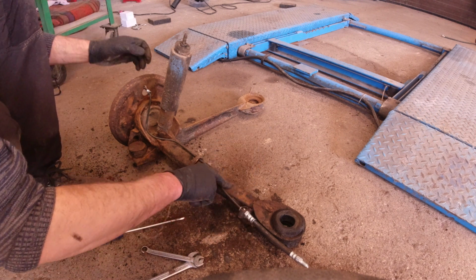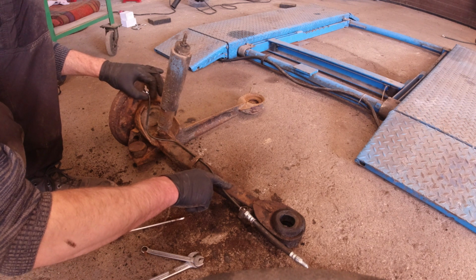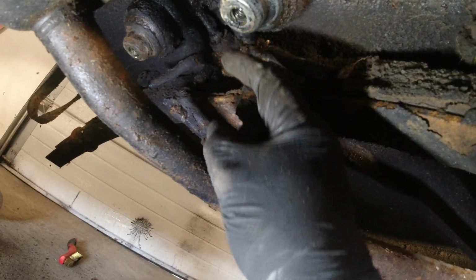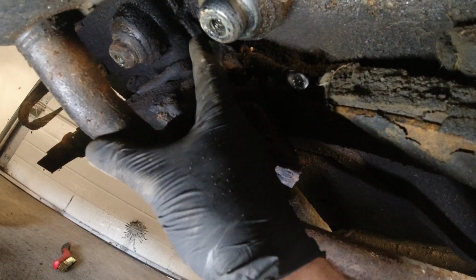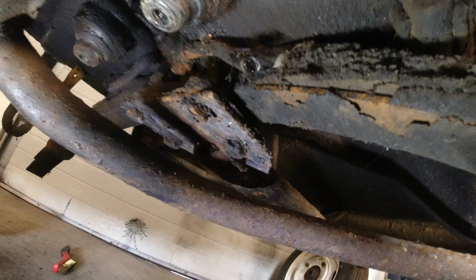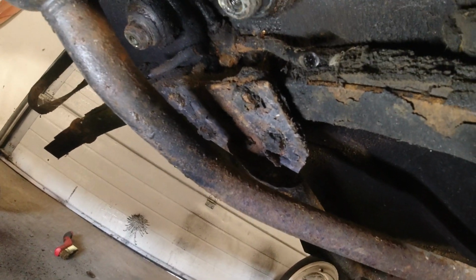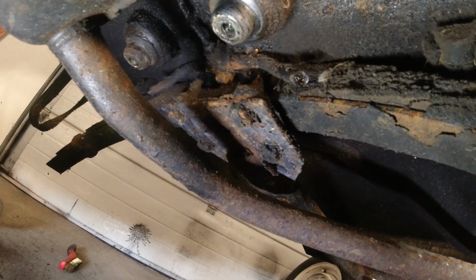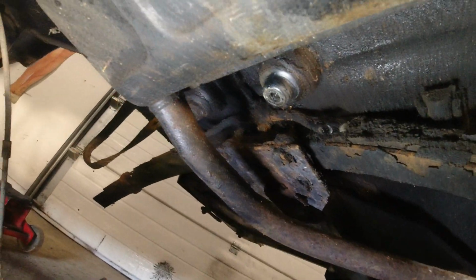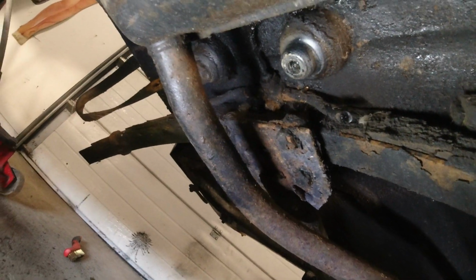So I'm gonna rip out the other side the same way as I did this side, and then take you back. So I have now taken off the other side as well, and now we have a bit better access. This right in there, which is difficult to see, is the divider of brake pressure, because this line goes to the master and then it divides to right and left rear wheel. As you can see, it's difficult to get at, especially with a wishbone on both of those mounts. By the way, the other one was full of water as well.